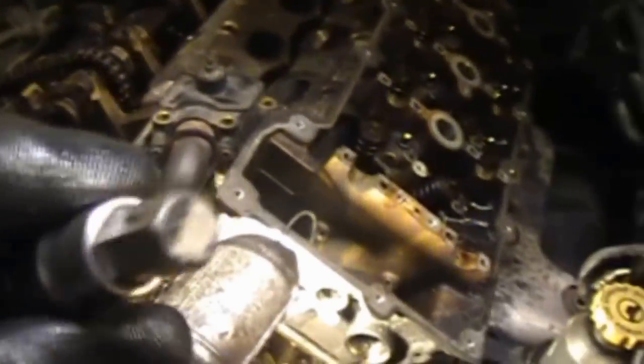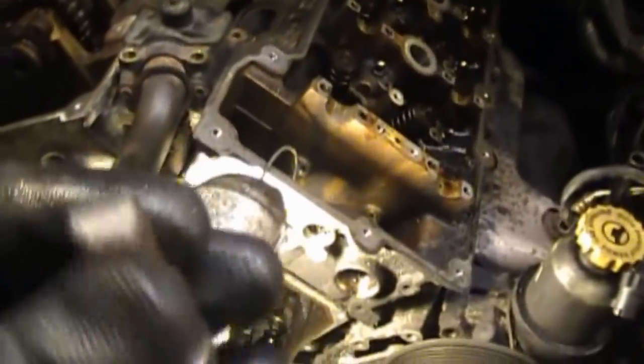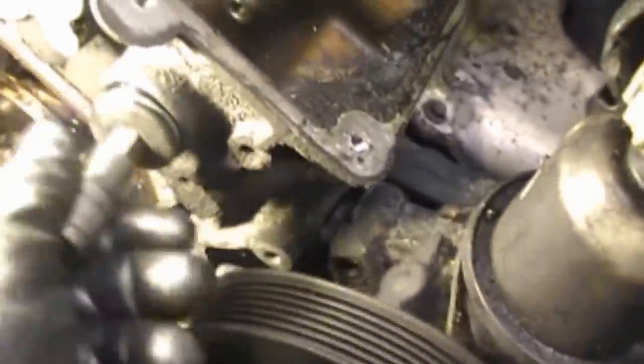Here are my guides - the plastic is completely gone on this one. These access plugs are what you need to get to the bolts for the head. To get that plug off you need a big socket - I believe it's a 12-point, like what you'd call a Torx or spline socket. Here's one of them right there - see how it's centered? Those screw in there. There are three of them total, just so you know. Once you get those out you can disassemble everything to get into the chain.